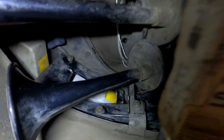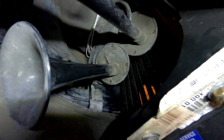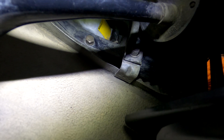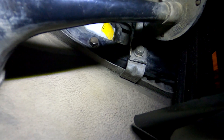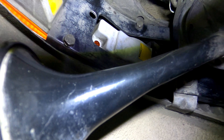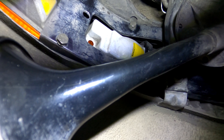As you can see, there are a few things going on here: you've got your oil cooler — mine is a 28-tube oil cooler — you've got the horns, and you can see the back of the lamp we're about to remove with the Bosch yellow sticker. There are two bolts, however one of them is partially obscured. You can see one on the lower right corner, and there's another one behind this black metal plate. That black metal plate is an aluminum extrusion that acts like a bash plate to protect the oil cooler in case of a front-end collision.